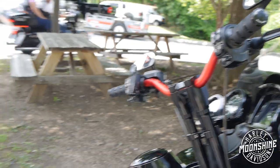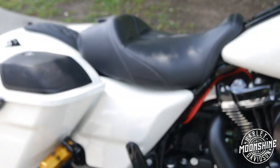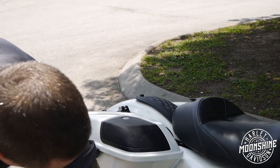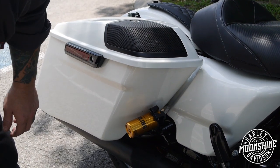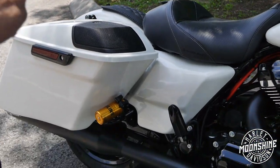We got the red bars, sweet PM grips. Another cool thing about this one — and one of the reasons we wanted to feature it — is that he has a detachable tour pack that you can put on here. So running the piggybacks on the top, which is pretty standard, isn't going to work. So we mounted them onto the front, in front of the bags, and we added some paint protection to make sure that if they vibrate they won't rub through the paint on his bags or side covers. You set them up so they don't protrude past the bike, and it's just super sharp looking. And then we've got the carbon fiber wheels, because everybody but Big Bear Choppers loves carbon fiber wheels.